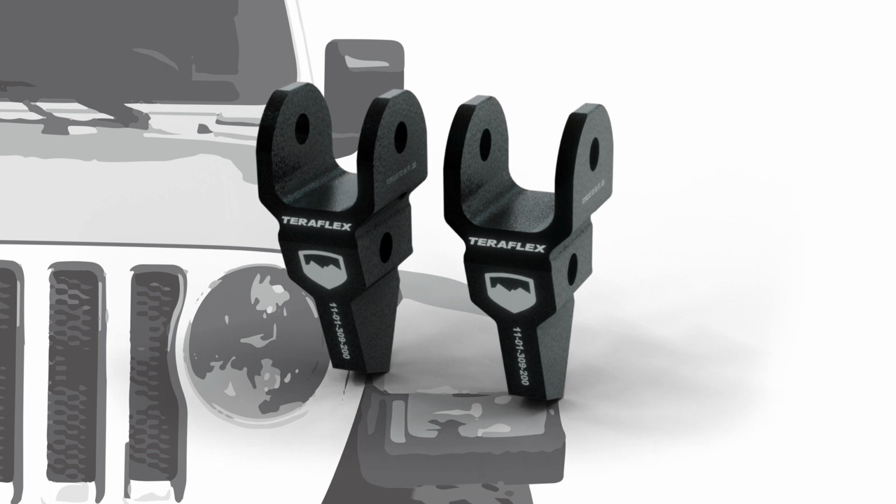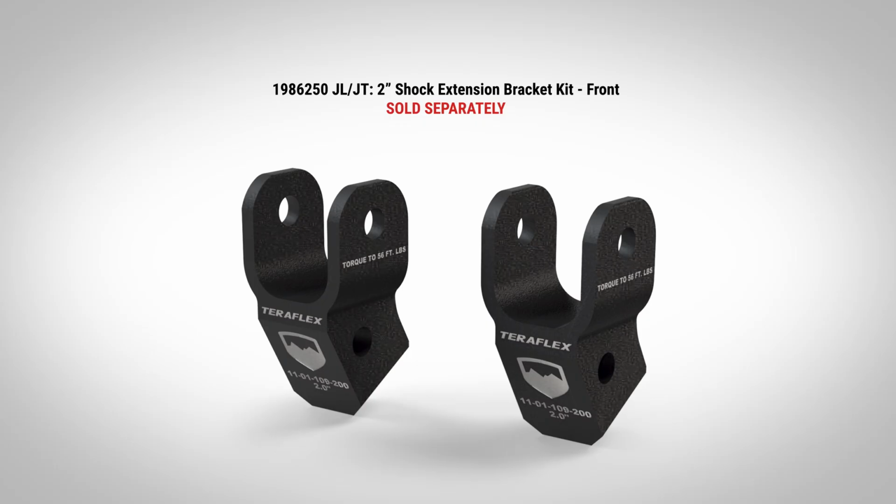2-inch bump stop extensions are required to install rear shock extensions on the JT. For instruction on how to install the front shock extensions, please watch our video on installing the TeraFlex JL Wrangler shock extensions. The front shock extensions for the Gladiator are exactly the same as what goes on the Wrangler.